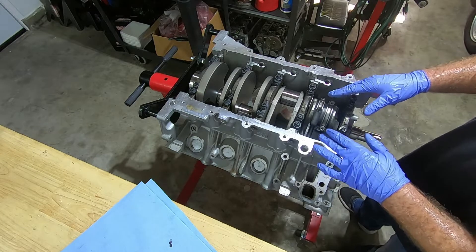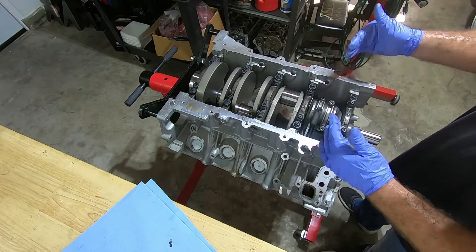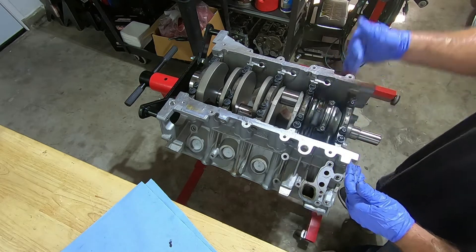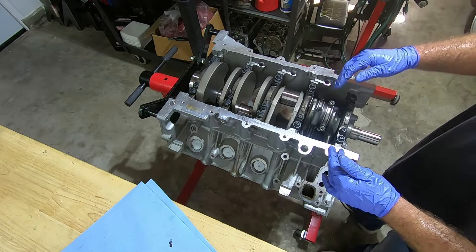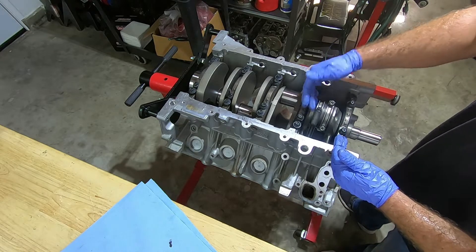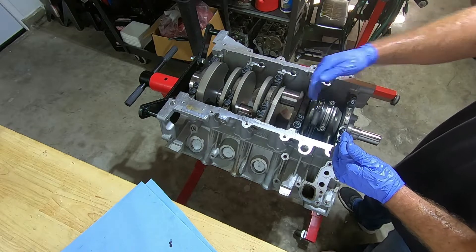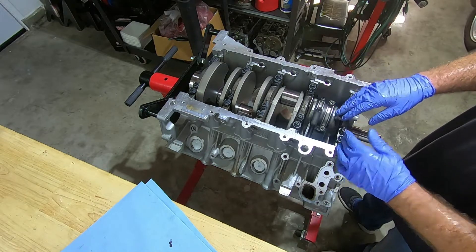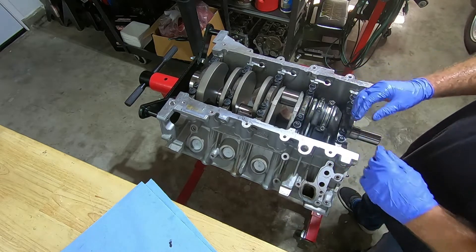What you can do to fix that is either swap the rods out, or what I'm going to do — if I take five and turn it to one, and one over to five, that essentially flips the pistons around. Now the gap will be on this side where the fillet is. So I'm going to switch these pistons over and see what we've got.